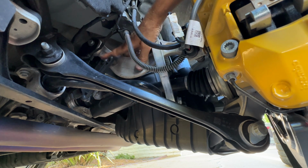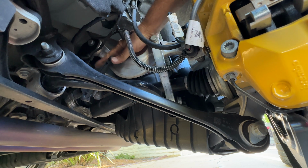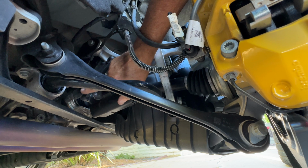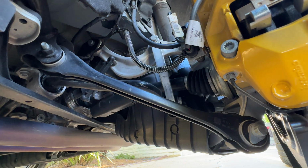And then, I don't know if you can see this, but this is a suspension position measurement strut, and there's a little electronic device here. There's one at the front, and of course they monitor the suspension at all times and feed into the computer that adjusts the adaptive damping and everything else.